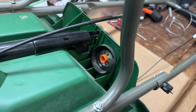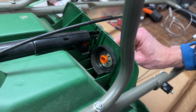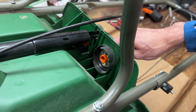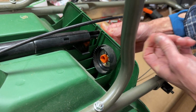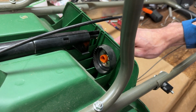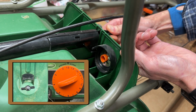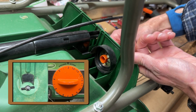Here's what's happening once you've filled the hopper. When you turn the dial to set the application rate, the back of the dial, which you'll notice is a cylinder that steps down along its outer rim, functions as a stop and therefore regulates how wide the chute door opens and in turn how much product flows through to this spinning impeller. On the highest setting, the chute door is at its widest. On the lowest setting, the door is barely open.